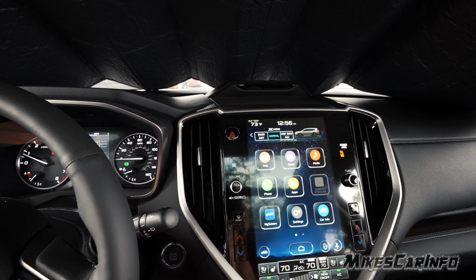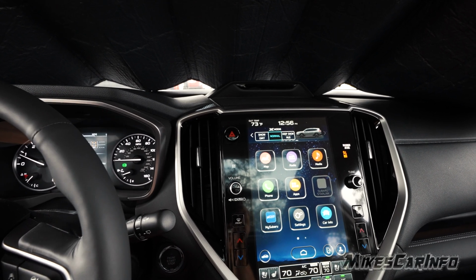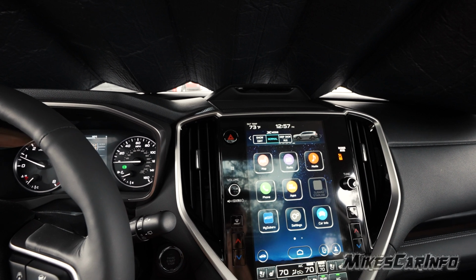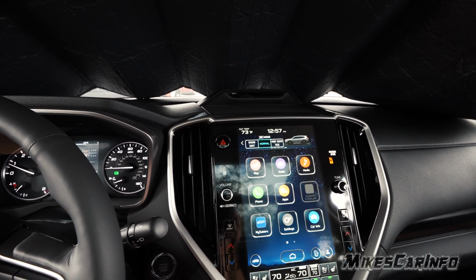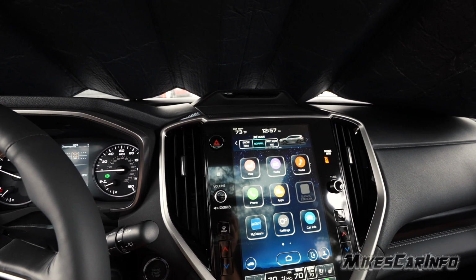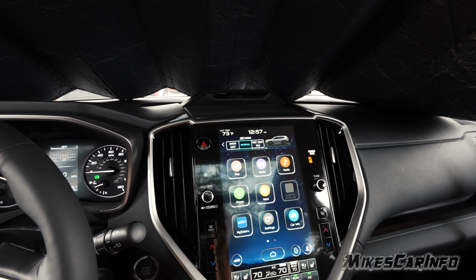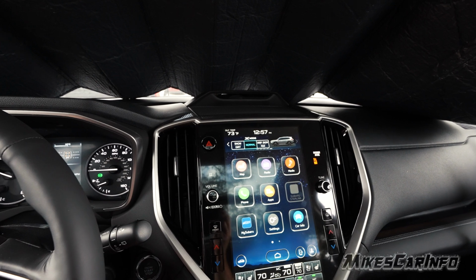So if you have the lane keep assist and you're looking at the road and paying attention, then it's going to keep that system on. But if for whatever reason it thinks you're not paying attention, it's going to alert you with beeping noises or vibrating or something like that, in order to get your attention, so you pay attention to the road, basically. And you can turn that system off, and I'll show you that in a minute, but it has the IR illuminator and it has a little camera behind that lens.